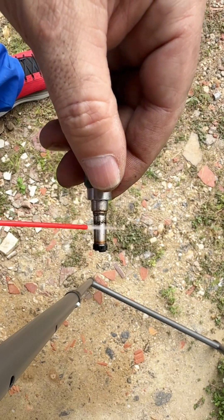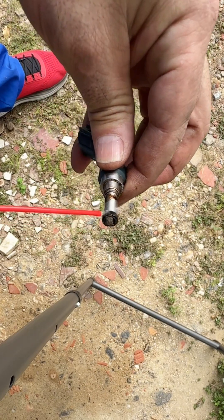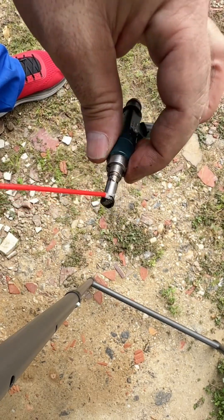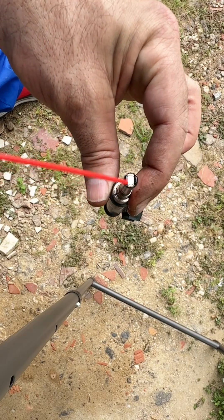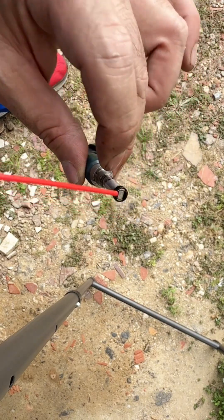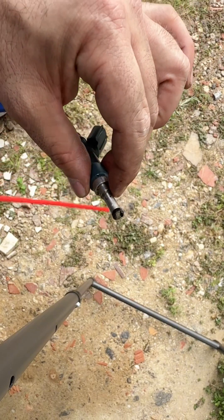With a little patience, just apply a little cleaner — I'm actually using some choke carburetor cleaner which really does the job. You don't want to put a brush or steel brush right here on the tip. Don't do that — you can damage the spray pattern of the injector.